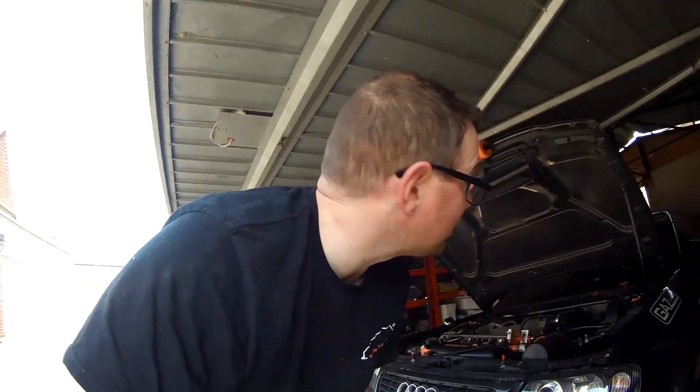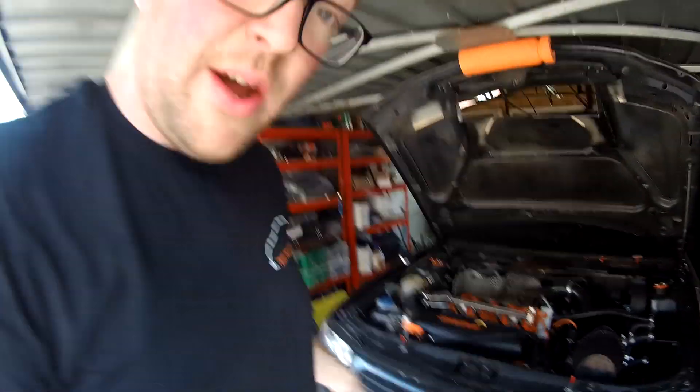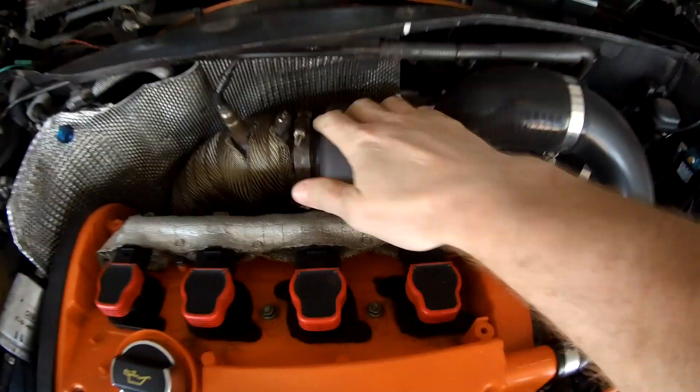The reason I'm collecting it is because it's a mix of G13 and MoCool coolant additive in there. It's not been in long, as you can see — it's still really clean and clear. So what I tend to do is filter that and then put it back in. So that's done. I just need to go under the car, get the P-clip off the oil drain, which gives me more room from above, and then lower the car back down to get access, because even though I'm tall, there's a bit of a stretch reaching over down here. Get that down and we'll get the turbo off.